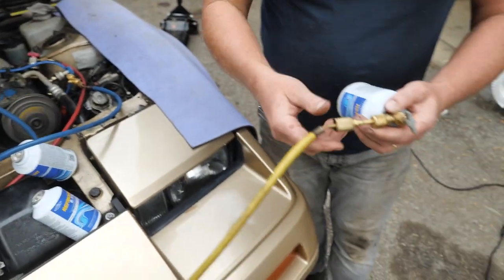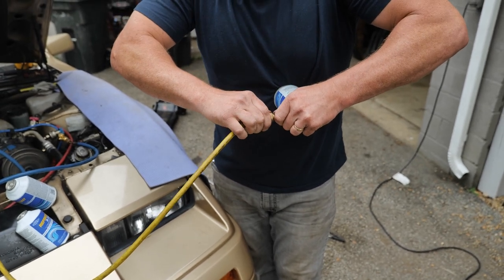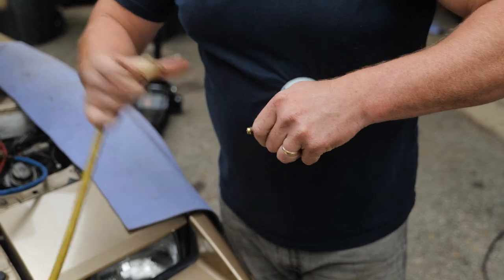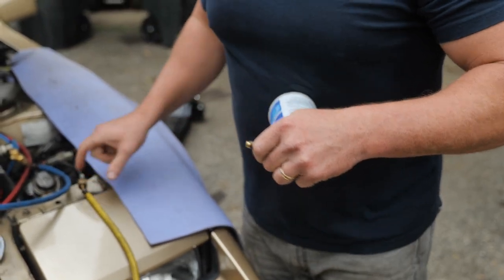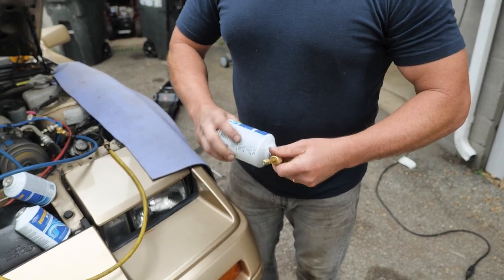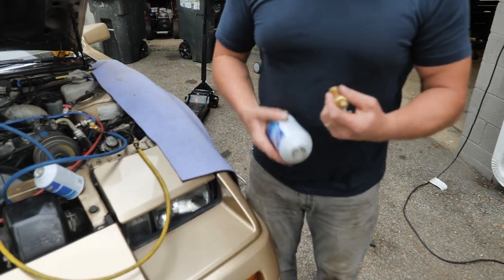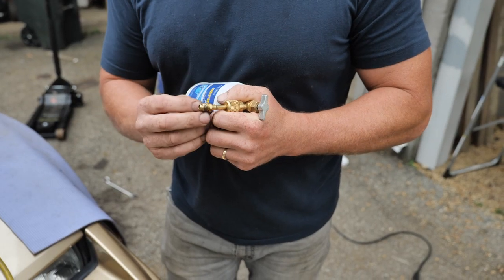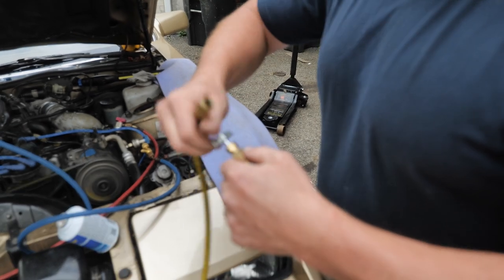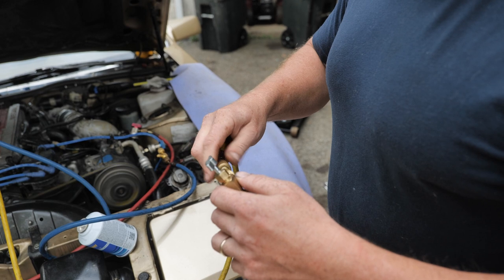So what I want to do first, I want to separate it here because of this check valve. I still have my low side line open. That's okay. I have a check valve here. Take this can off of here. There'll be some very small amount left. Switching. Bleed the air out right here. And let me close this because I have that valve open. I don't want to just dump liquid in here just yet.